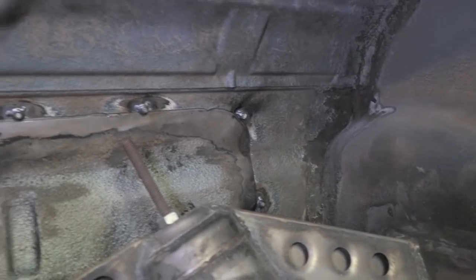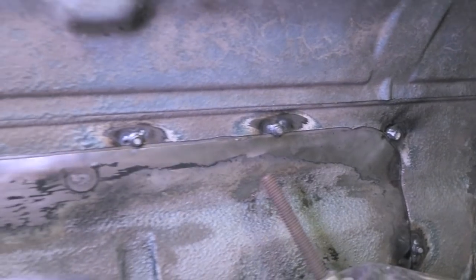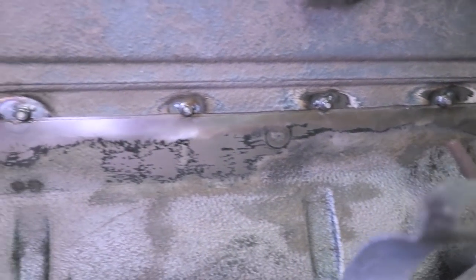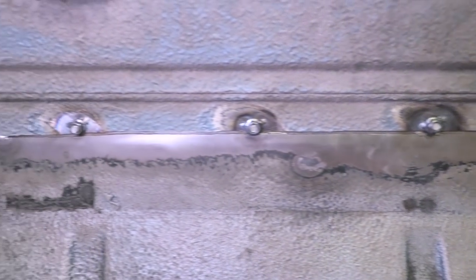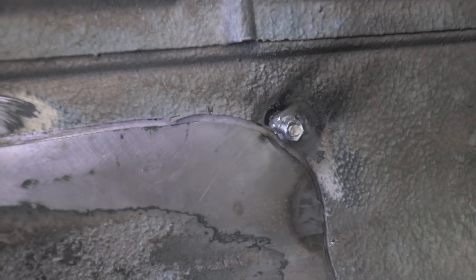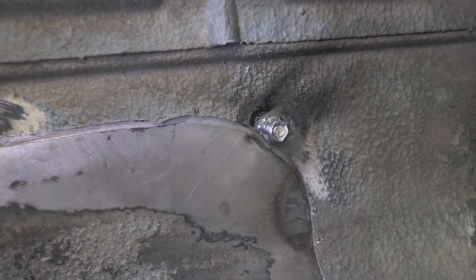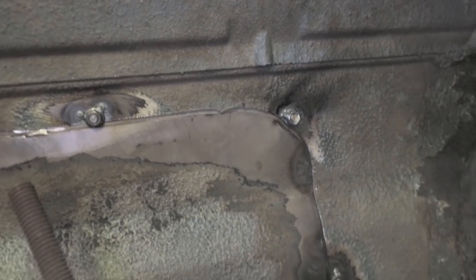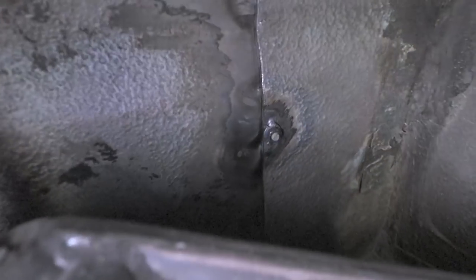Okay, here inside the engine bay, and I got all but two of these welded in. You can see I tacked on the right, tacked on the left. Some of these got a little extra hot, so I'm hopeful that I didn't weld the screw to the nut. So I'm gonna go inside and try to get all the screws out and clean up the threads to make sure that it's gonna be trouble-free next time I need to take this out. Also, I'm going to create some method of getting to these lower guys. They're hidden behind this brace.